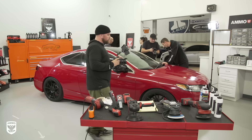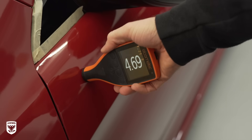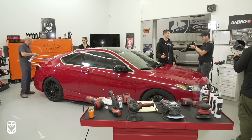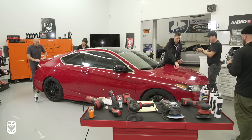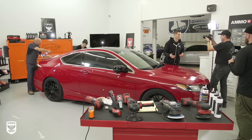Let's have some fun with the clear bra measurement. On uncovered paint it reads about 4.69 mils. On the clear bra it reads about 11 mils. So the math gives us roughly 6 mils of clear bra thickness — which is about right for a five-and-a-half-year-old film. You can actually see lines in it where the quality cutoff was around that time when clear bra really started getting good.